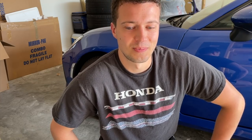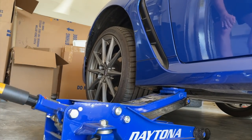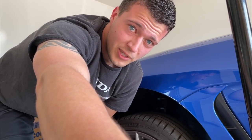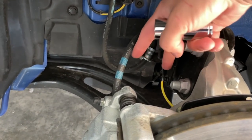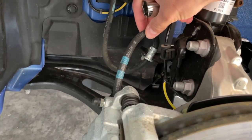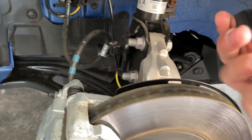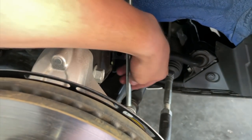It's about 24 hours later now. Last night I did the front right corner — took me about four hours, but I learned how to do it and I feel pretty confident now, so I'll show you how to do this side. I already broke these lug nuts before I jacked the car, so they should come off pretty easily. Sadly, this install marks the first time I've ever taken off a wheel too. First thing I'm going to do is disconnect the ABS sensor and then disconnect the brake line — I think that's a 12 millimeter. These I think are supposed to be 19 millimeter, but I'm using a three quarters.